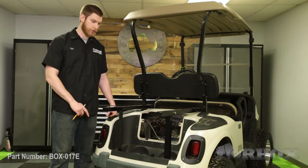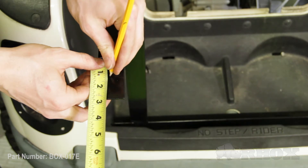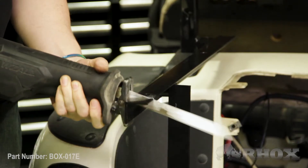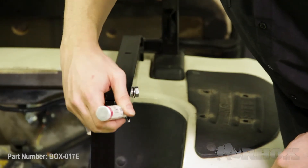Some earlier revisions of the mounting kit for the utility boxes on the RXV have a little bit of extra material on the end, and because of that extra material, the new Econo box will not fit on those brackets. So we're going to trim off a little bit of that extra material. This modification is pretty simple — we're going to measure from the middle of the back mounting hole for the utility box, measure back one inch, make a line, and cut that excess material off. I'm going to put my safety glasses on and use my Sawzall to cut that excess material off — you could also use a cutting wheel or similar tool. And as always, anytime we expose any metal, we're going to cover that up with some paint. Now that our brackets are trimmed, we can go ahead and install our utility box.